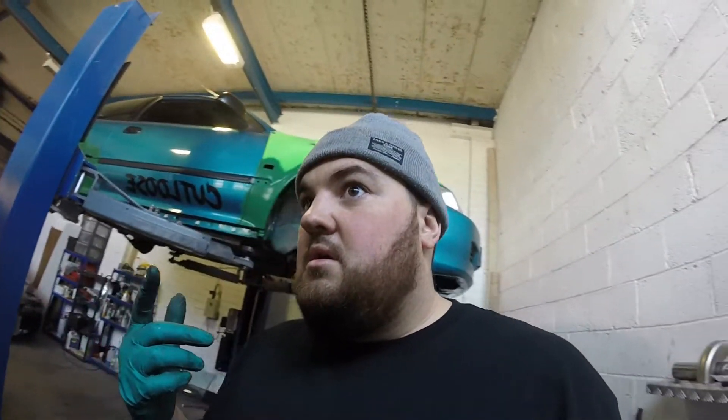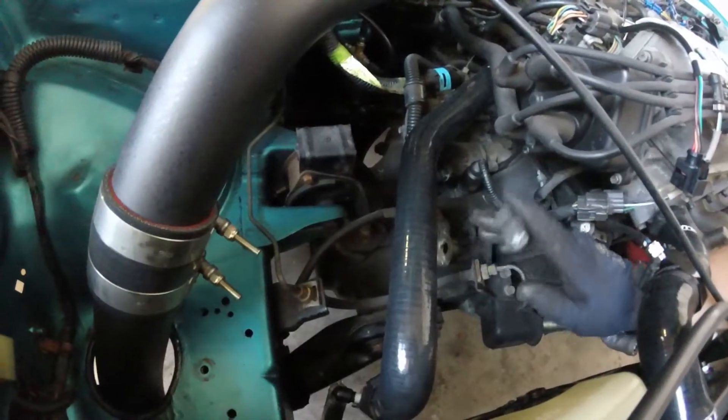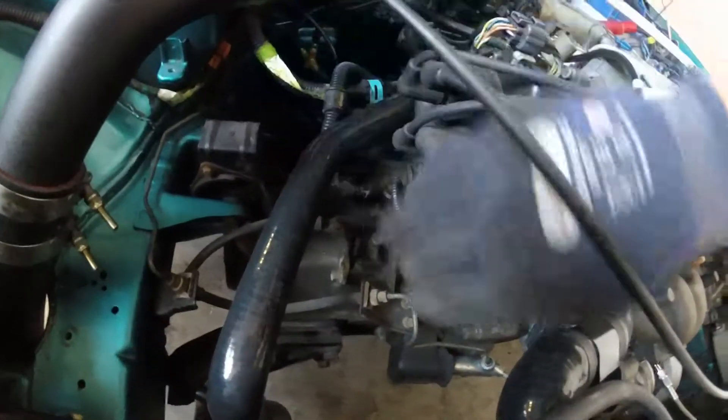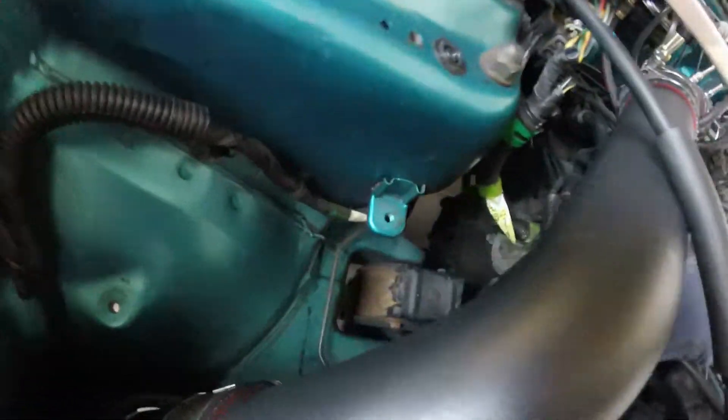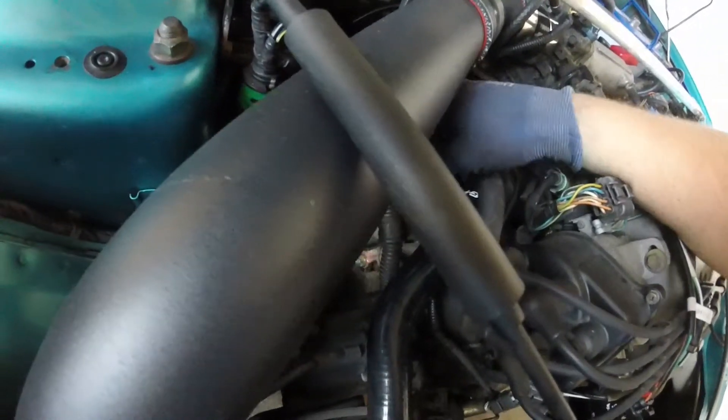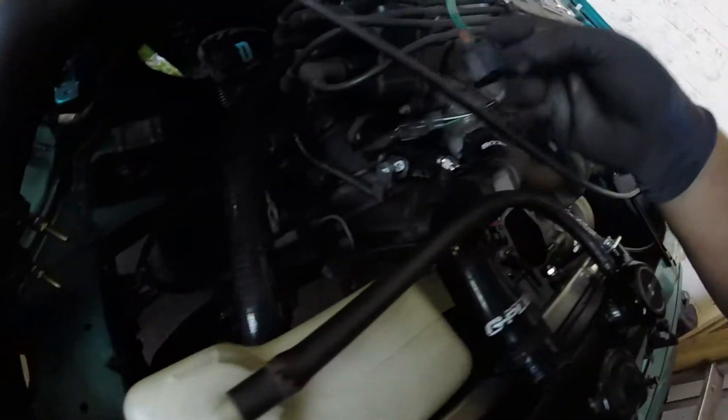Going to go to the top and I'm going to take the starter motor off - disconnect the wires. Need to just unplug it from here. This is a 10mm nut. Need to undo the starter motor, which looks like it's two or three plugs. It's under this bracket - it's already undone. Looks like it's had a starter motor replaced in the past. Luckily my lambda sensor is already unplugged.